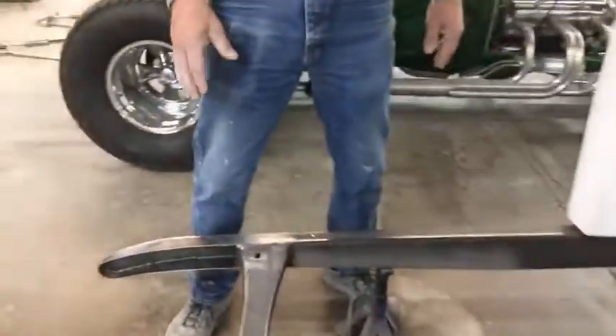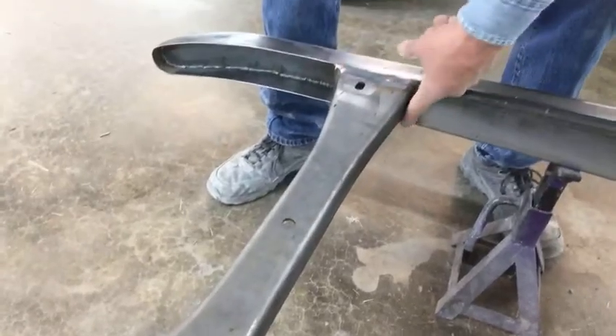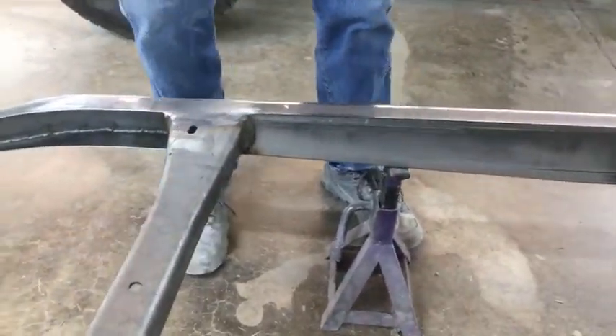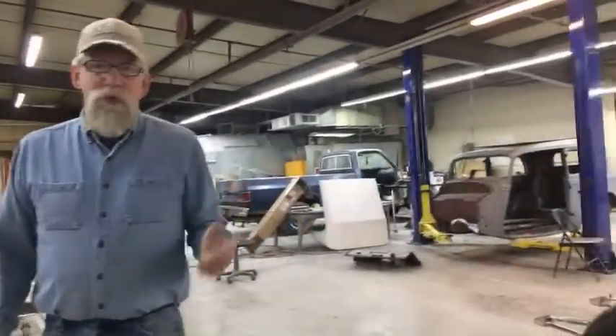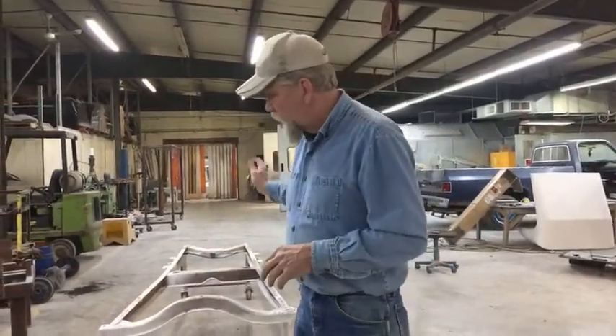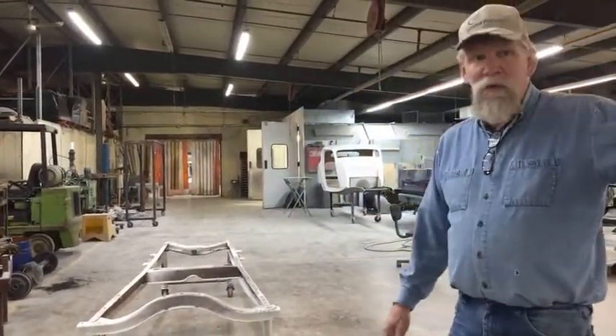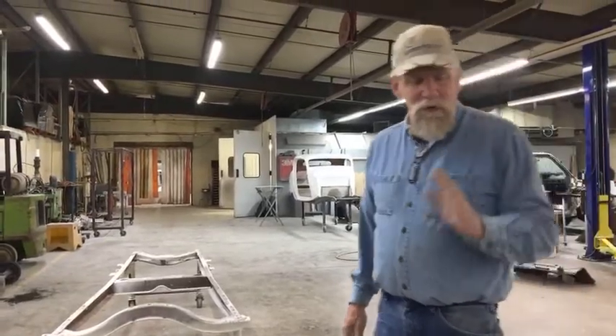From the horns forward we don't generally box it, but occasionally we do if the customer requests it — it's more for aesthetics. But this frame is fully welded, fully boxed, 3/16s steel. You can put a lot of horsepower in this frame and still not have flex, twist, or problems. If you're going to make a modern-day hot rod, definitely box the frame and put modern brakes on it — these cars weren't designed for highway speeds of 60, 70 miles an hour or more. There are a lot of ways to do it: independent front suspension, independent rear suspension, straight axle, radius rods, four-link, wishbones. There's no one way to do it — that's what makes hot rodding so cool. It's everybody's idea, and if it works, go for it.